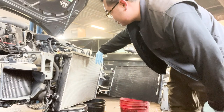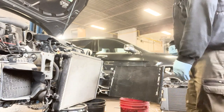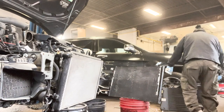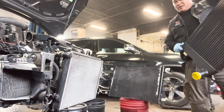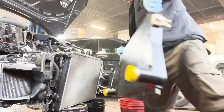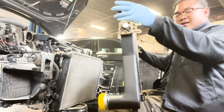So here I cleaned out the rad — I blew it out. I mentioned to clean your rad and your AC condenser. Don't forget to clean the auxiliary cooler and the DSG cooler on the side of the crash beams.